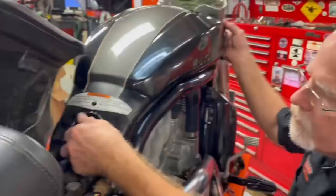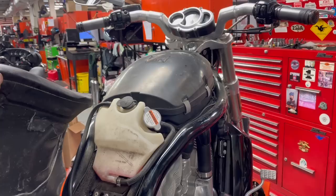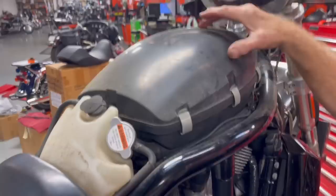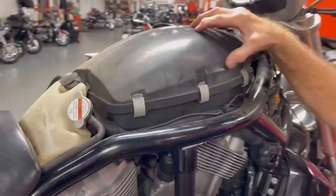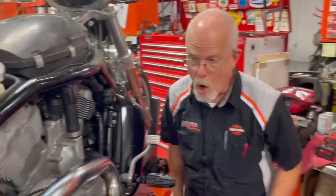Now I can lift this up, pull back, and lift out. We found the radiator reservoir so we can check the level and top it off. We found the air cleaner — the air filter is right here, and underneath the air filter are the two spark plugs. If you take this whole unit out and follow it to the very front, there is the battery — the positive is on one side and the negative on the other, so you can put your alligator clips on and charge it up. To replace the battery, you have to remove the air cleaner assembly: pop it off, take out the air filter, take the bottom out, and slide the battery out.